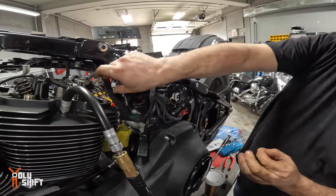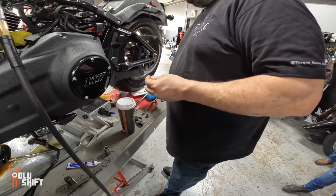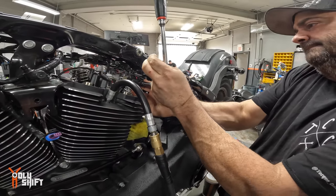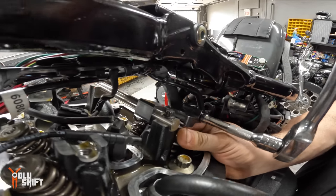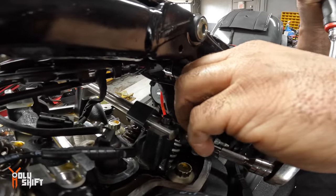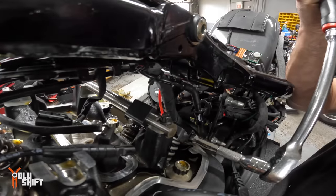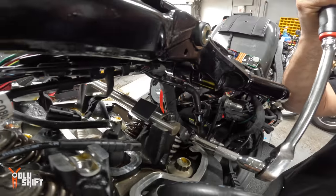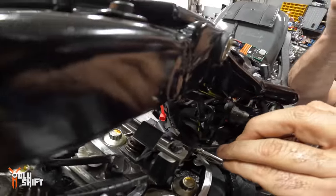This is the not fun part, when you've got chubby fingers trying to put these little keepers on. Those are the same springs I got. My springs are TTS springs. Now I can compress this down. And once you do a big bore build, you need different springs, right? Yeah, for sure. It's really the lift of the cam. Higher cam. With this spring, anything over 475, I would do. It's good to 485. There's one.